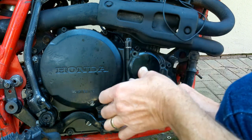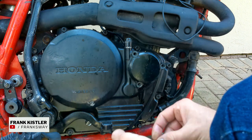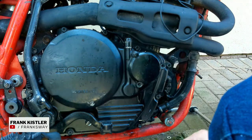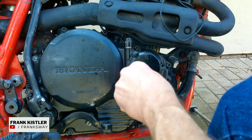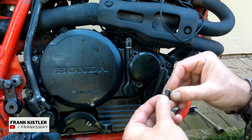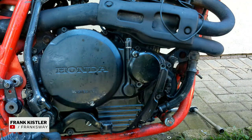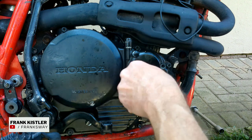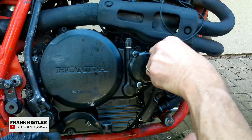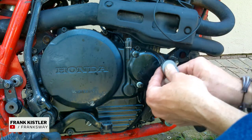Right, if this O-ring is faulty, you can replace it. But what I want to have a look at, just check the length of the bolts, all equal length. I'm wondering why they cracked this one on the side. I think I'll just put a little bit of a spring in there. Okay, let me just get that quickly and we'll carry on just now. Alright, let's add three spring washers to these bolts. I've checked the depth. The depth is fine. I was just worried about why it cracked. It obviously was over tightened at some stage. Alright, let's quickly close up here and then we carry on.